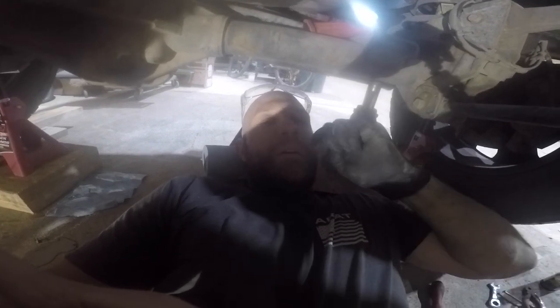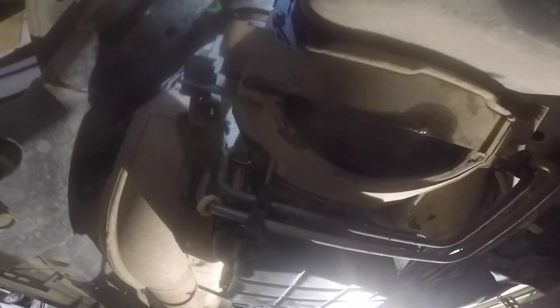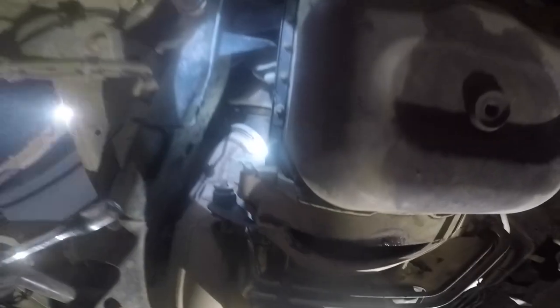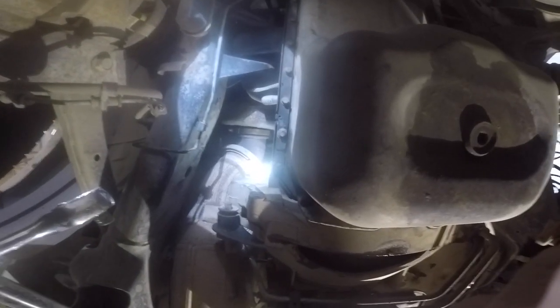All right, removing these torque converter bolts is kind of a pain in the ass. There is a bracket that sits right here. That's the bracket right there. It's got 4, I think, 15 millimeter bolts. Take that guy off. That's pretty much your only hope to get these bolts out. And then I used a ratchet with an extended handle, and you need an 18 millimeter deep socket to get in there. Once you got that, I was able to break it loose, but it takes a little bit of elbow grease. So prepare for the suck for that guy, because you got 6 of them.